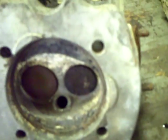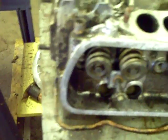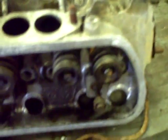This one wasn't stuck on as bad. It was on the right side of the vehicle. The thermostat was missing in this thing. It had no thermostat. They just had this rod right here kind of stuck in the fins and holding the flaps open on the fan housing. For those of you who are familiar with this kind of engine, you know what I'm talking about.